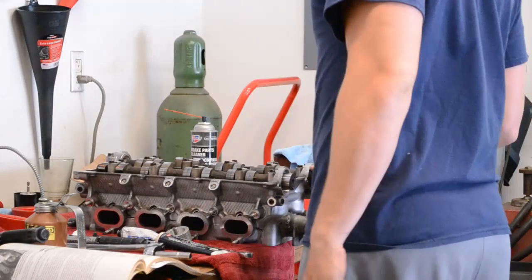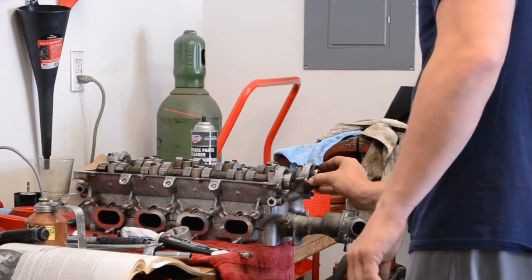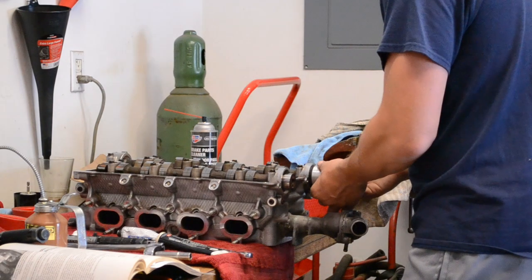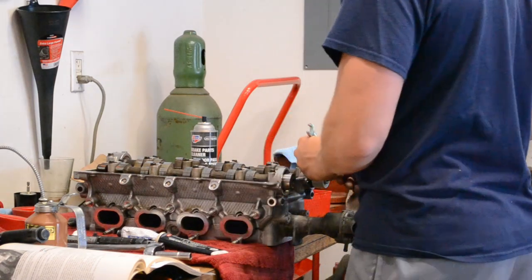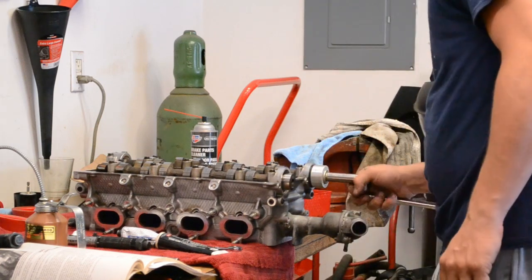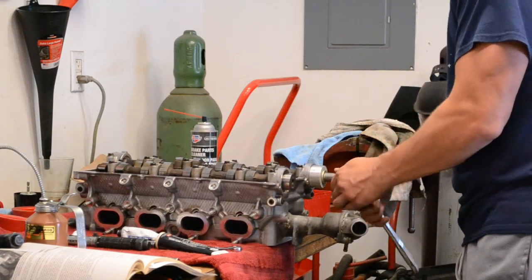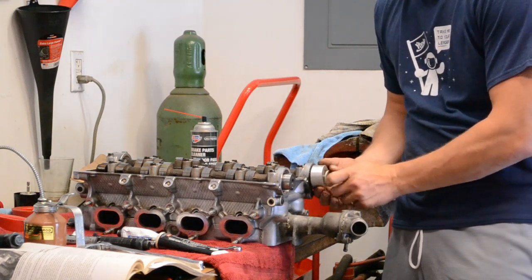I'm going to show you one of my favorite tools — this is an oil seal installer; it goes on the cam. We've got everything reassembled, and this goes on with a little bit of oil from my oil can. This cam seal installer is machined so that when you use the OEM bolt and washer, it threads on and then pushes the seal in proportionately and evenly so that you don't get warping. Once it stops, it's all the way installed — normally you'd hit this with a mallet and a 32 millimeter socket. We're at the stop, which means our seal is installed, and it is seriously that easy. I don't know what they sell these for — they don't charge enough money. That's how good of a tool it is.